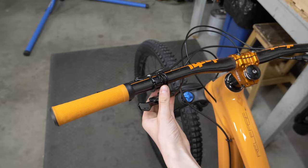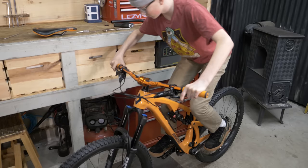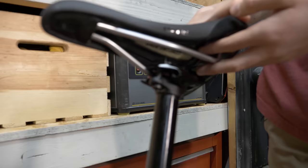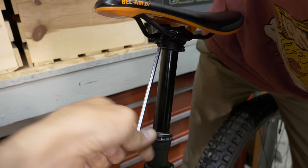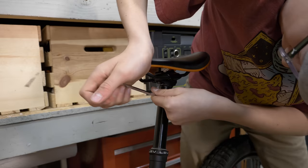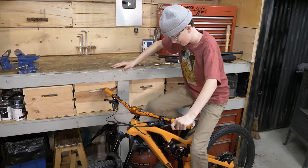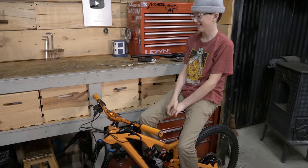It's really key to make sure that you can reach your dropper post. Now we're going to throw the new SDG seat on the bike — unscrew one side quite a bit, get the front bolt too, slide the seat over to the side, and pivot it upwards. Push it in most of the way, put that down. Tighten this up until it flattens out — it adjusts the angle so the saddle gets nice and flat and is comfortable. Tighten the back up until it's nice and tight. Milo sits on it — how's the seat feel? Really good, actually. Is the angle good? Yeah.